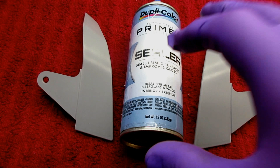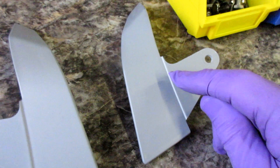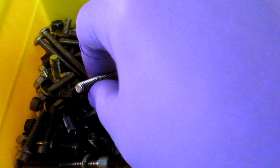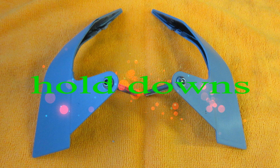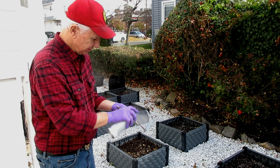Out in the garage, I want to make a handle so I can hold these parts, because if I grab it with my hand there are areas you might not see unless you're crawling under the bike, but I'm going to see them. I always have bolts and nuts that I can make handles with. A lot of them have paint already on them — makes it an easy choice. Just like we painted Dale's part yesterday, I made a handle on the headlight bucket. This makes a convenient way to hold it while painting without touching it. We're finally up above freezing at last, so we just want to have one coat of primer on this — just to act as glue to hold our test paint on.